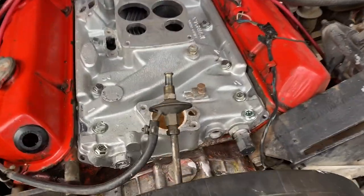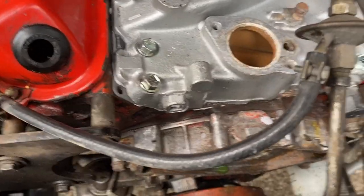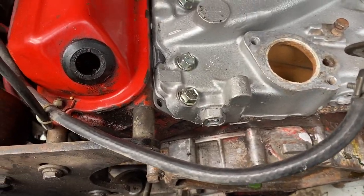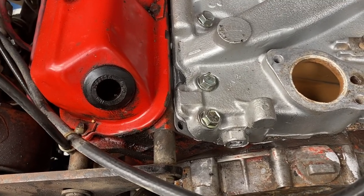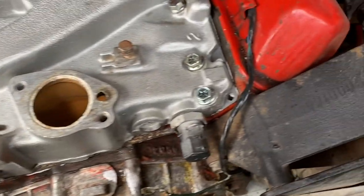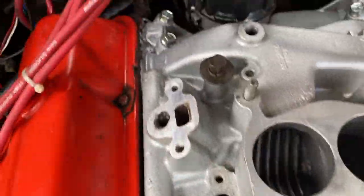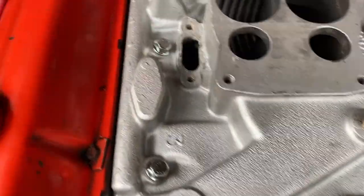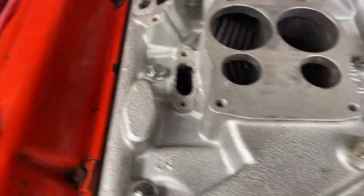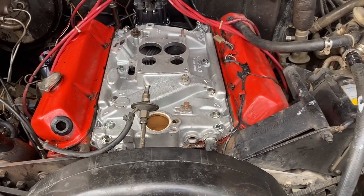Alrighty, just a quick update. So, I had to work fast. Silicon was drying. So, put the gaskets on after cleaning everything up, and silicon on both sides of the gaskets. And some new bolts have gone in. The longer bolts go in the middle. 1, 2, 3. 1, 2, 3. See it there? And the shorter ones all at the end. And then I'm just going to get the torque wrench out and torque this sucker up. And then when I get time tomorrow, I'll try and wire everything back up and put the water pump back in.